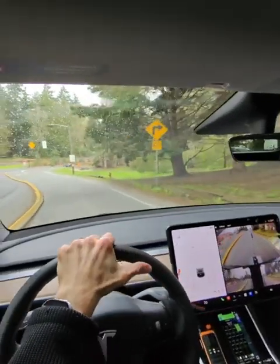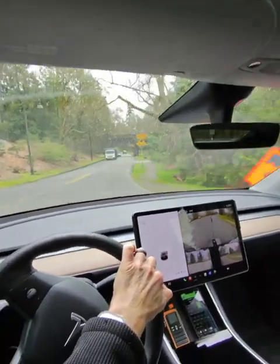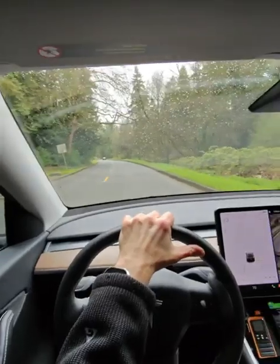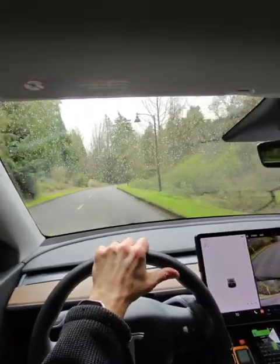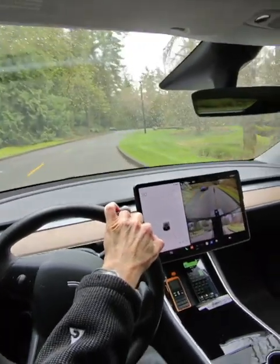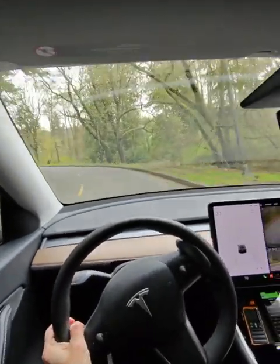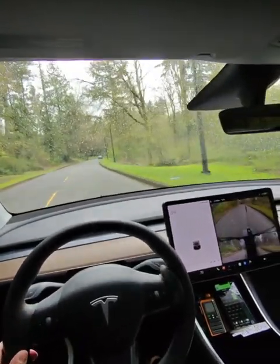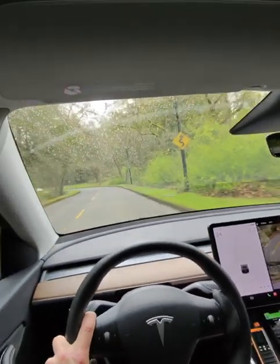Here's a warning: never do what I do — I'm just showing you what's possible for me. Because I've made so many mistakes and ruined so many things, and this might be a dumb idea. You certainly would not want to plug a 100 watt radio — anything over 50 watts — into a cigarette lighter outlet. Look in your car manual to see what the fuse is, and make sure it's a newer car with good wiring like Teslas do. Even a 50 watt could potentially cause problems with a DC socket.